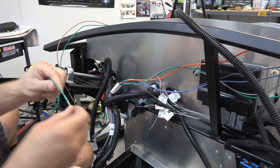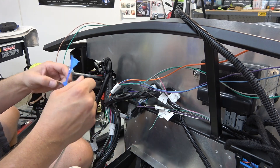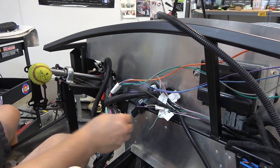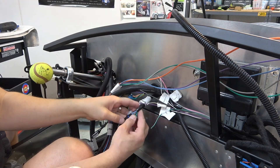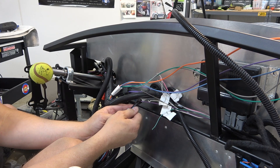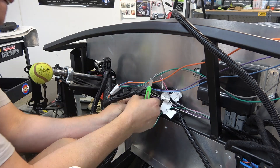This one's labeled fan thermal, which I'm going to connect behind the dash here. Then this one is — I think that one was electric choke, which I've already terminated here, but they don't need to be in the engine compartment. They live right here — that tan one and that green one. So I was going to undo this and try and pull them back through and then coil them up here to keep them for another day if I need them.